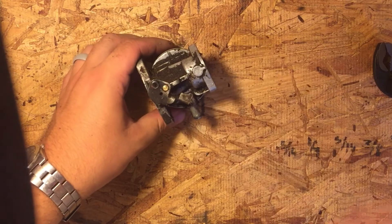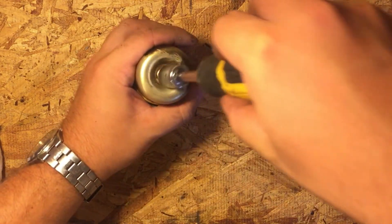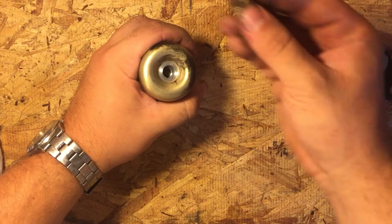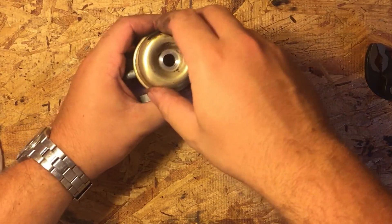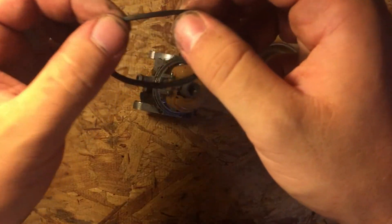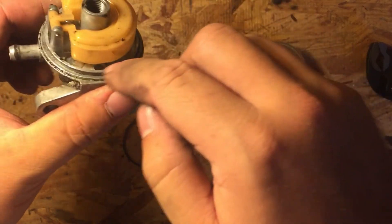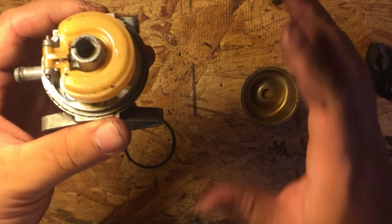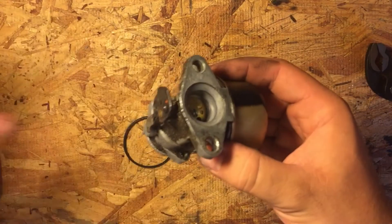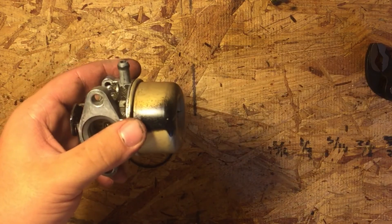Since I have the old carburetor, I'll just show you what that gasket looks like in between the bowl and the bottom of the carburetor. This takes a half inch. There's a little washer on the bottom of this bolt — right there is this little washer. Sometimes this can also get cracked, frayed, or broken, so just check this too. If you do replace just this, remember to clean off this whole surface here so that the new o-ring seats and makes this connection tight. Most kits come with a whole new carburetor, so sometimes it's nice to just replace the whole thing. Any comments or questions, put them in the comments section below. Thanks for watching — I'll catch you in the next one.